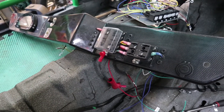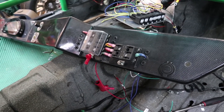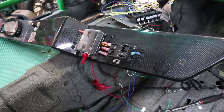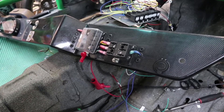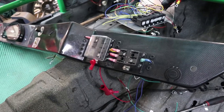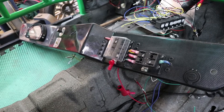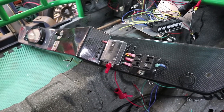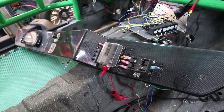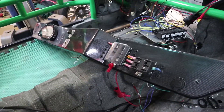Some of the things that will come on when you just turn the ignition on will be like the AIM dash, and you could use the radio or the cool suit, things like that. Those will have fuses in this terminal block. Then everything else like the fuel pump, the fans, the starter circuit, and the ECU — that will all come on when that terminal block is live.